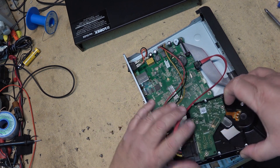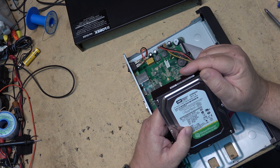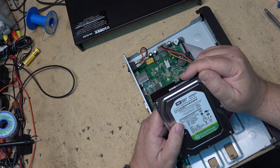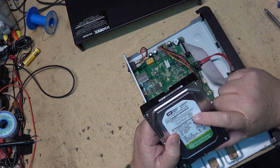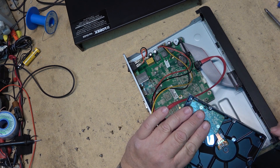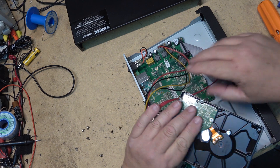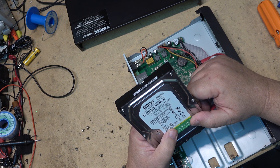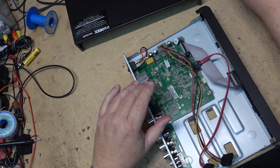I have the step-up model which has a bigger processor chip with a fan and heat sink, and a much bigger hard drive. What does this thing have in it? It's a 2012 unit. It looks like 500 gig — it doesn't even say on here. When it booted up before it said 500 gig, but when I listened to it, it was just beep beep beep. I took the top off and heard the drive start to rattle and spin up — so the drive is shot. Yes, it's a 500 gig. Anyway, I happen to have another hard drive I can install — it's a Seagate.